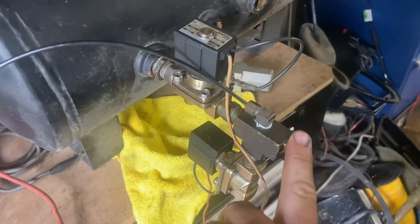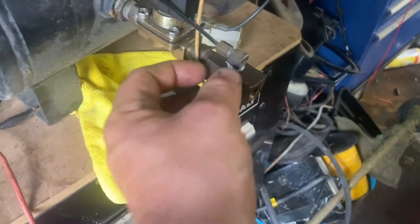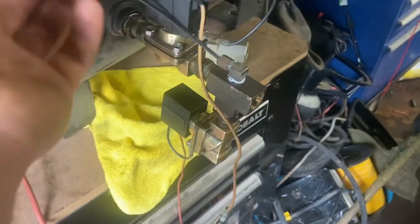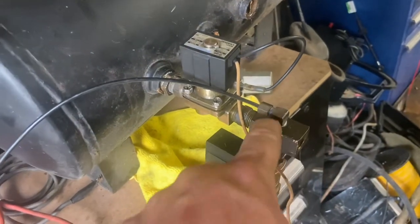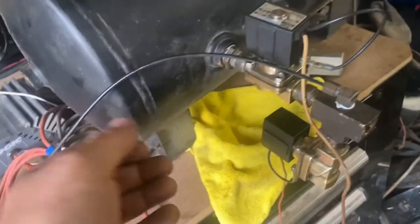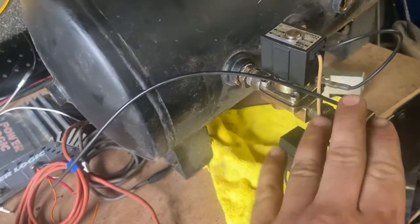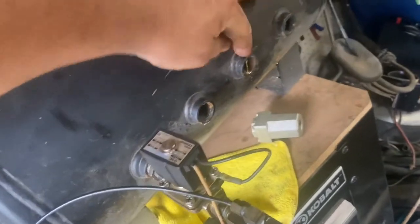Your air will come through and feed into the airbag. What you'll have here is either a compression fitting or a push-to-connect for your airline that hooks directly to your airbag. You don't have to have a tee with a gauge fitting on it, but all this is — you're going to have a small line going back to a pressure transducer if you've got digital gauges, or back to a gauge at your dash or column to give you the air pressure at that airbag. Then you can replicate this whole process on each airbag all the way across — that gives you your full system.